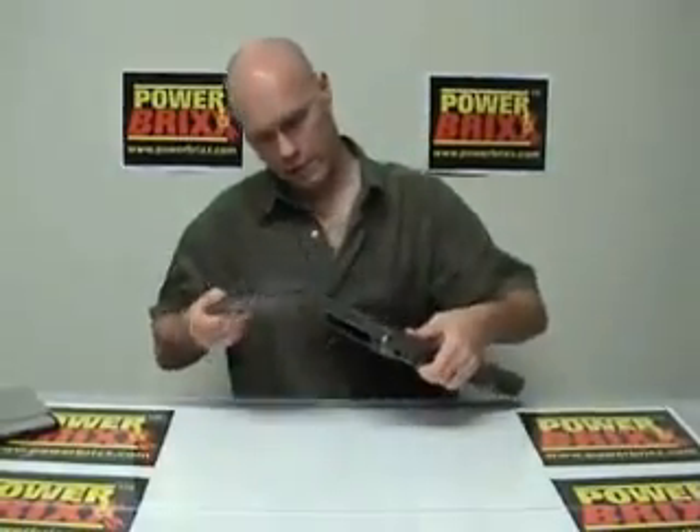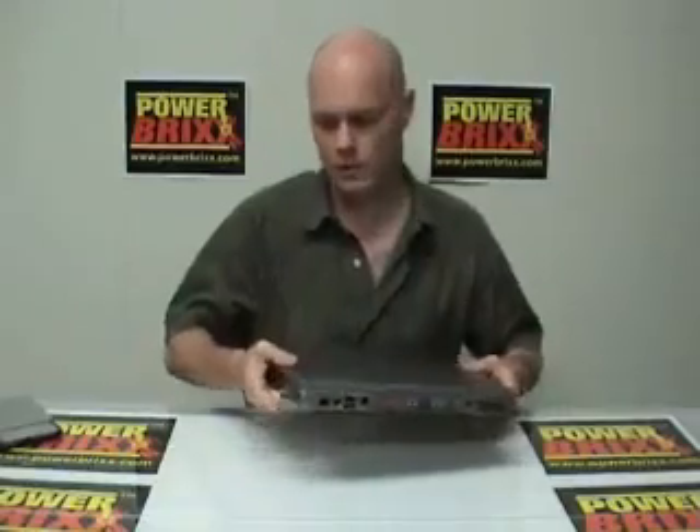We transferred the housing; at this point we can take the reassembled drive and reinsert it into the computer. You should be doing all this with the computer turned off — I would even suggest taking the battery out and making sure it's not plugged into the wall. In this case I installed a DVD plus/minus rewritable dual layer optical drive with LightScribe capability into this Dell. You could replace a standard DVD drive or a DVD/CDRW combo drive. The computer will typically be able to play and read CDs from any optical drive installed, but you will need DVD viewing software, DVD recording software, and CDRW recording software.